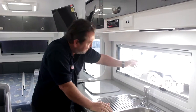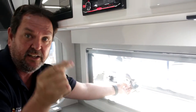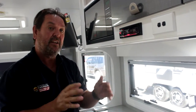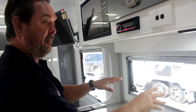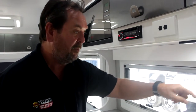My big plus for these windows is that they are double glazed. You'll note that you can't squeeze your fingers together on the edge — that's because it's a bubble acrylic window with two skins, an outer skin and an inner skin, sealed together like a bubble, like what they have in the UK and most of Europe. That air pocket acts as insulation: it traps hot air trying to come in and stops cold air from your air conditioning dissipating straight out. It also acts as noise reduction. And if a stone hit it, it wouldn't crack straight through because it's got two skins — you could get a crack on the outer skin but you'd still be totally waterproof because of the inner skin.